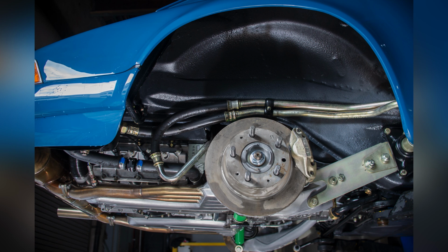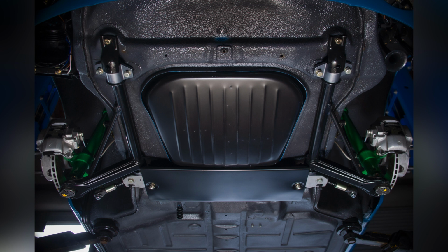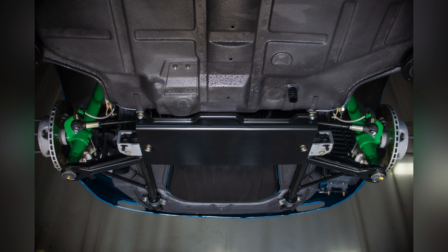bars are hollow Sway Away, hollow 20s in the front, and in the rear are also hollow 26s, Sway Aways in the rear. I never overbar these cars. People make that mistake all the time. I don't do that. The sway bar in the front is the kit that I sell. It's the reproduction of the 18 millimeter factory early turbo setup through the body of the car behind the gas tank. So it looks 100% factory. It is also hollow. Not a lot of people know that, but that bar is made special for me, and it's a hollow 18 millimeter factory-looking 930 turbo, and then I use all the other Porsche sway bar hardware, so it looks 100% factory.